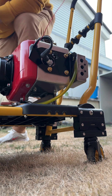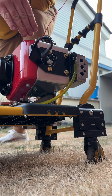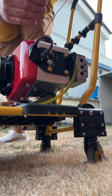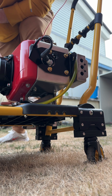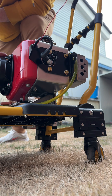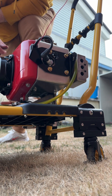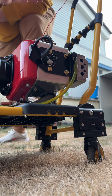To start it, you can see me working the recoil. What I'm doing is bringing the piston up to the very top of the cylinder — top dead center — so that when I pull, I'm getting more momentum as the flywheel comes around and the piston goes down and back up. If you try to start it at the bottom, you'd just be slamming into the top. Pull it until you get the piston back at the top.